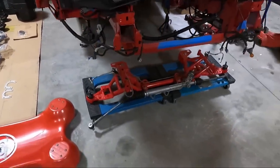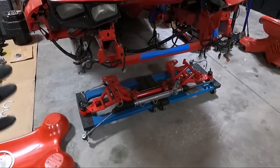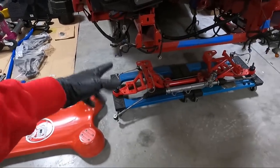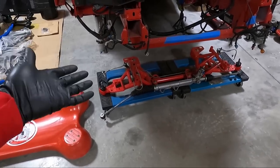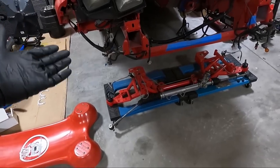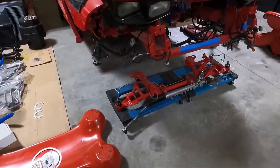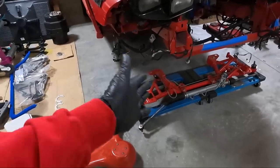After driving my son's Camaro, I hated the rod-ended stuff he had as far as suspension goes. I want this car to be a nice driving car. So if you notice, I took the spindles off and they're setting right here. I had stock uppers, which I'm going to keep, but I was thinking about replacing those aftermarket lowers with a set of stock lowers. The problem is nobody sells a reman — I can't think of the company, but I don't trust their products. So I'm going to leave it like that until we're going in on assembly. It also makes it a lot lighter and it's not wearing on the ball joint leaning over.